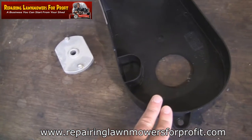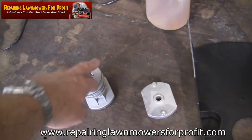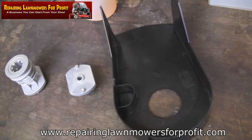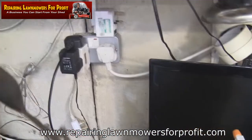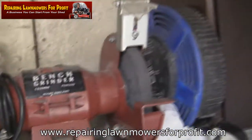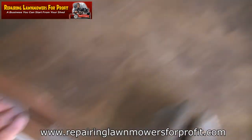We'll put on this blade adapter and belt, make sure all that's back on, then push the belt guard over the top - so the drive will be nicely cleaned and working again. Just quickly before I do that, I'm going to wire brush off this blade, take all the old grass off, and run a new edge on it with my little grinder. You can see that's the back edge - I'm just going to sharpen that leading edge. If you haven't got a grinder, just use a file. Somewhere I've got a blade balancer.